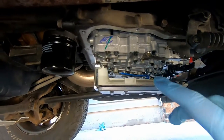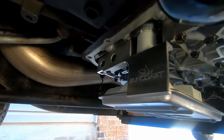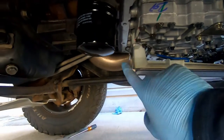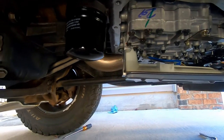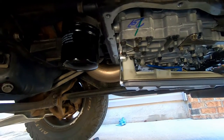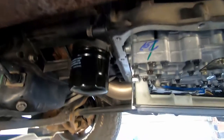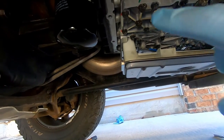As you saw in the last update we did get the valve body assembled - all the bolts tightened down to 9 foot-pounds. I've since put both filters on - we got the spin-on filter there and the deep pan filter there. Up front you guys will see we do have the brace from Suncoast Transmissions. I'll be honest, that brace is kind of a pain in the butt. I think later designs moved this brace from the front to maybe the side or the back. The reason it's probably not used anymore is that trying to get those eight bolts around the billet aluminum and the white plastic piece going up into the transmission was kind of a pain. I ended up using swivel sockets and some pretty loose socket extenders, but I did get it tight.